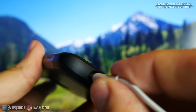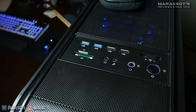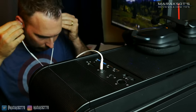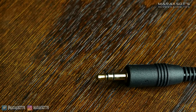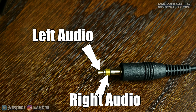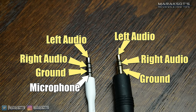This type of jack is currently most common on smartphones and newer laptops. Most desktop PCs and many older laptops will have separate jacks for both the mic and the headphones. Although these jacks look just like a four pin jack and your four pin headset cable fits in just fine, there is a significant difference in these jacks which is what is causing the mic not to work. Another type of pinout is what is known as a three pin or TRS plug, which stands for tip ring sleeve. On a three pin plug, the tip carries the left audio channel, the metal ring below that is the right audio channel, and then you have the sleeve which is the ground. If you're watching this video and your headphones work fine when plugged into your computer's headphone jack, but your mic does not work, this is why.